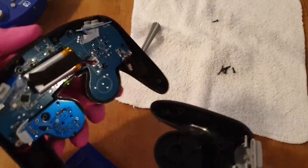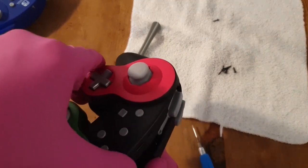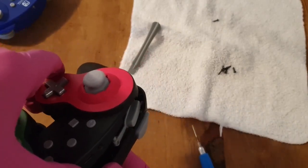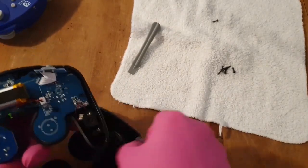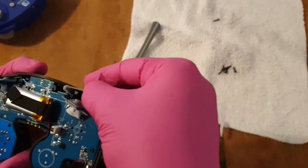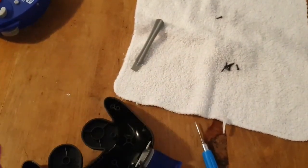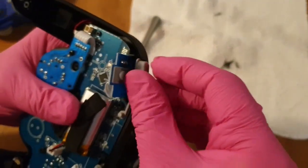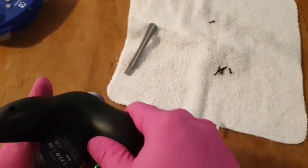It's a good idea to test and make sure the lights turn on and that it is in fact functioning before you put things back together. That way you don't have to disassemble for no real reason. You should put these in first on the other side - it's real simple, there's just a slot right there that slides into there. That tab right there tucks behind there - it's very straightforward. Controller disassembly usually is very straightforward.